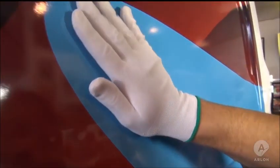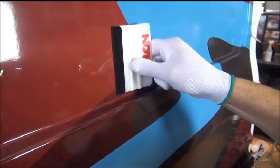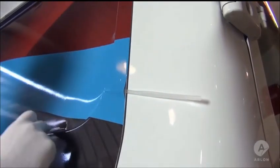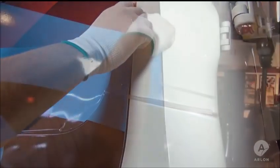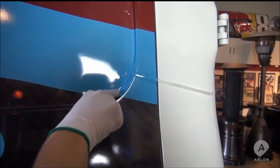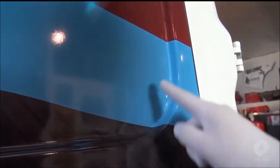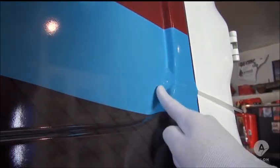Finally you will reach the bottom of the channel. The six inches of vinyl previously uninstalled have absorbed 100% of the stretch. Apply this part, touching out any bubbles that may have developed. The channel is done and there is no distortion or loss of color. This corner is sealed at the top and bottom points — only heat the vinyl in the middle area. Heat away from the corner and continue to push the trapped air towards the straw. Then apply the flat area and add a little bit of heat to push the final bit of air out through the straw.